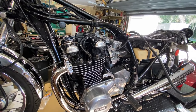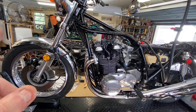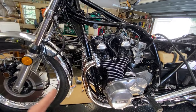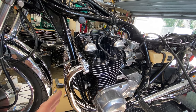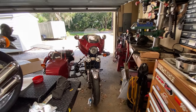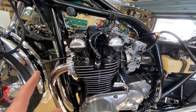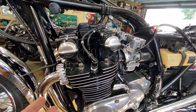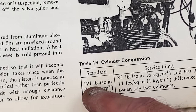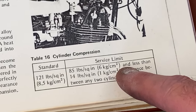Based on the way some of the exhaust valves look with that white powdery stuff, this thing is probably burning oil down to the valve stem seals. I don't think it's rings, the way it's running. I did do a kind of leak-down test and couldn't really detect anything coming out past the valves, inside the crankcase, blowing out the exhaust, or at the intake. Base compression according to the manual is 121 PSI on page 82 of the factory service manual. That's standard; 85 PSI is the service limit minimum, with no more than 14 PSI difference between cylinders.